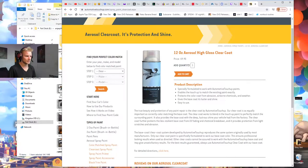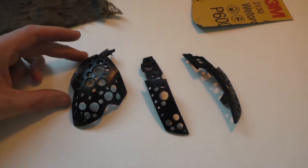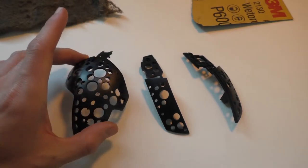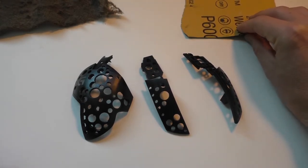The only thing is, since this automotive clear coat is not meant to be used with the Rust-Oleum paint, I would just wait 48 hours for the Rust-Oleum to completely dry and then sand it down lightly with 1000-grit sandpaper before applying it. If you use this right over the Rust-Oleum before it's fully dry, the chemicals might cause a problem — maybe a month later — you don't really know. The first thing you want to do is take your mouse apart. You could paint it while it's still together, but if you want to do a really good job, take it apart. I have another video on how to fully disassemble the G402.